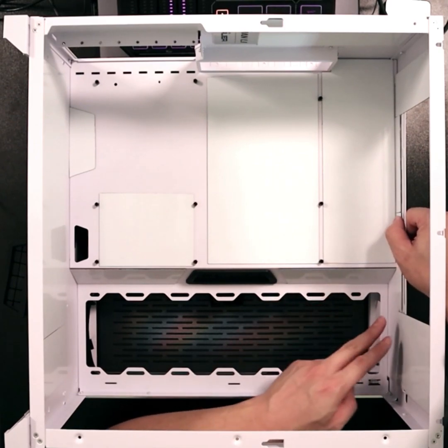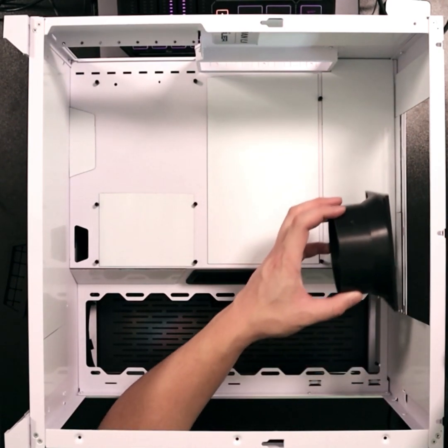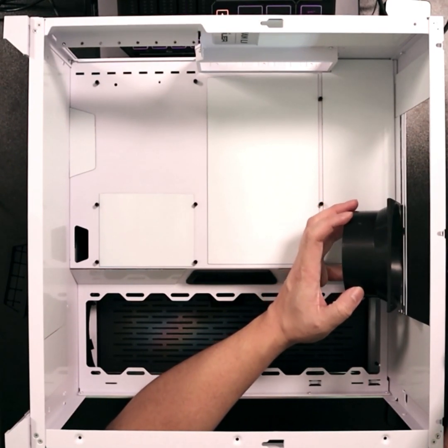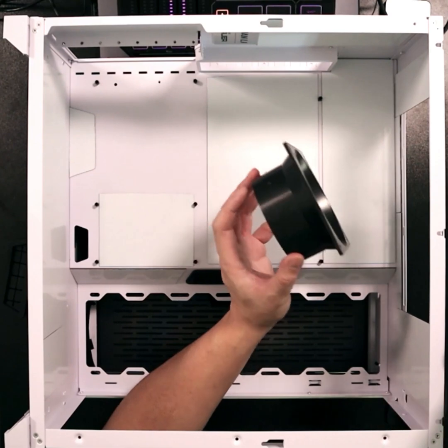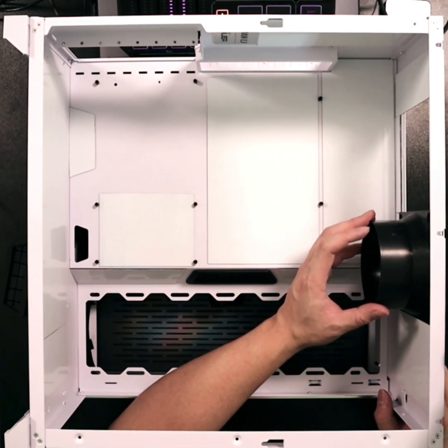single core performance than the TRX40. The TRX40 is only 3.8 gigahertz, but I don't have enough PCIe lanes using the X570 or X670, at least not to do the 6 hard drives, 3 hard drives, which consist of 2 each. So either I don't do RAID or what the heck? It moved already. Anyways, see how possibly disastrous this is.